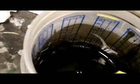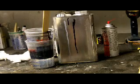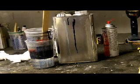Another way to know if your product's sprayable, usually, see the bubbles in the base coat around the edges after you stir it? It's thin enough. Now, primer's a different story. You definitely want your primer reduced down enough to spray it, but you also want a large enough tip in the gun to spray it.